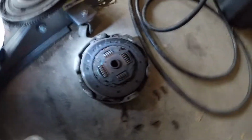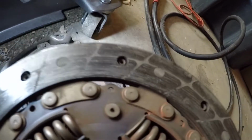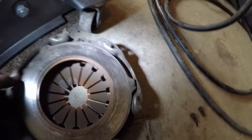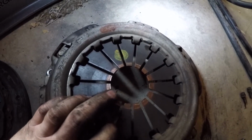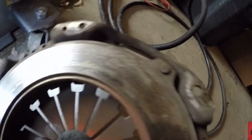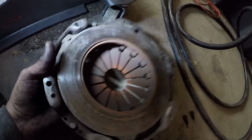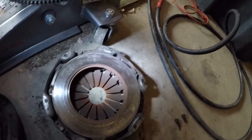It's all out. Here is the old clutch. So there's really no groove left in it at all. And then this is our old pressure plate. The wear on the fins isn't really too bad. There's a small lip. But again, you can see this thing's just pretty glazed up. And there's no cracking, so it didn't get too overheated, despite my best efforts at abuse.